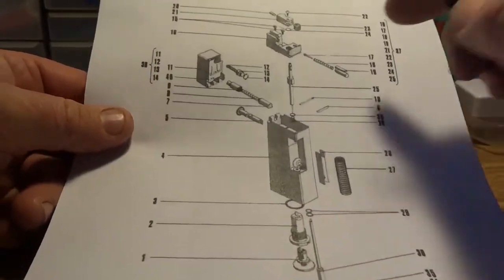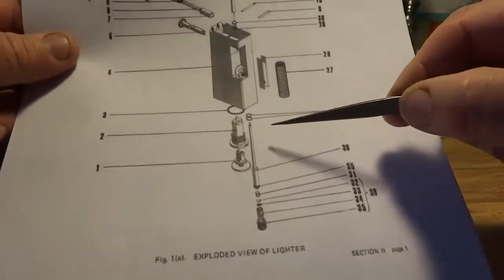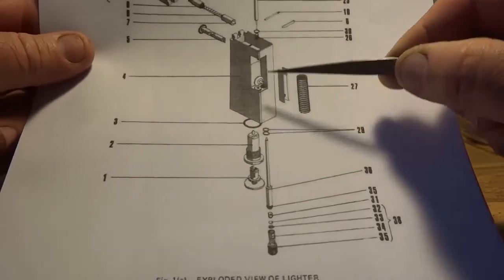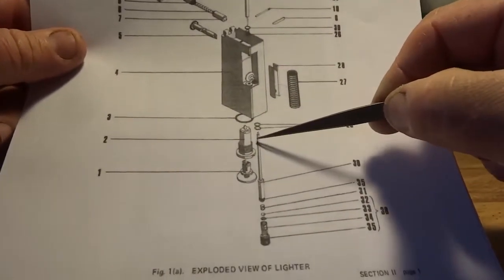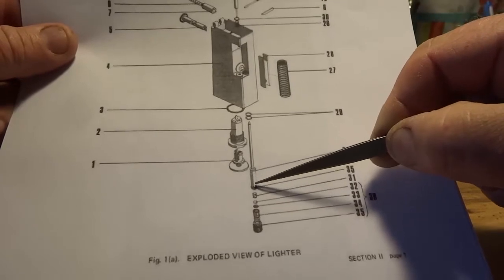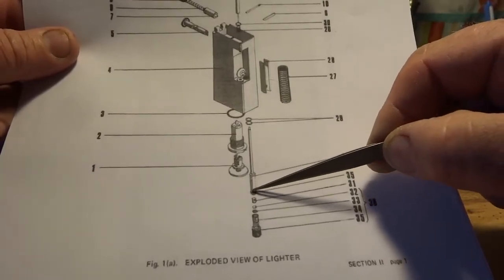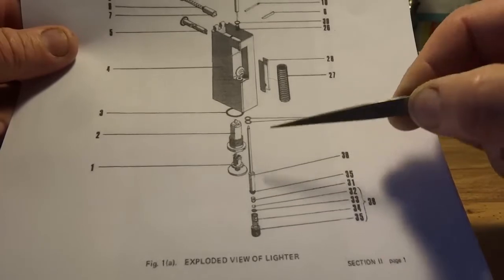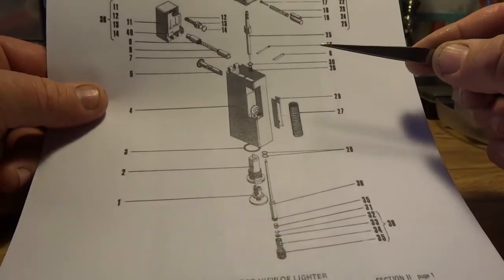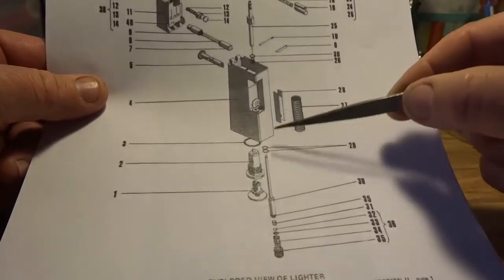I've never had to rebuild the stoppers on these. These stoppers go up and lead the gas flow. This here is what I call a burner valve — the top part is a little thinner. All the plunger does is push down on it, because inside this long burner valve there's another little burner with a plunger on the inside which is spring-loaded, and it plugs up a little hole at the bottom to keep gas from protruding through.